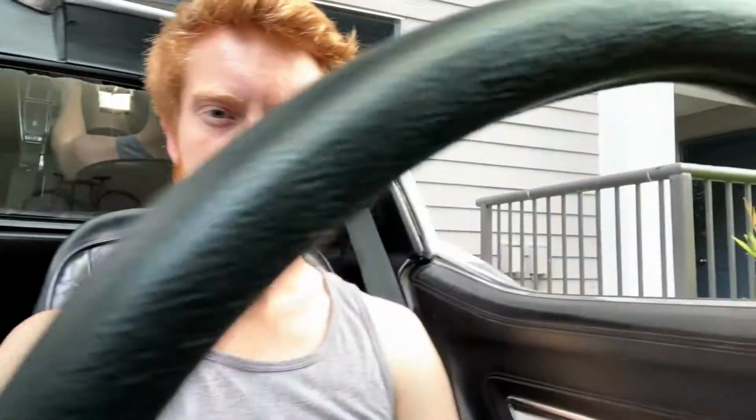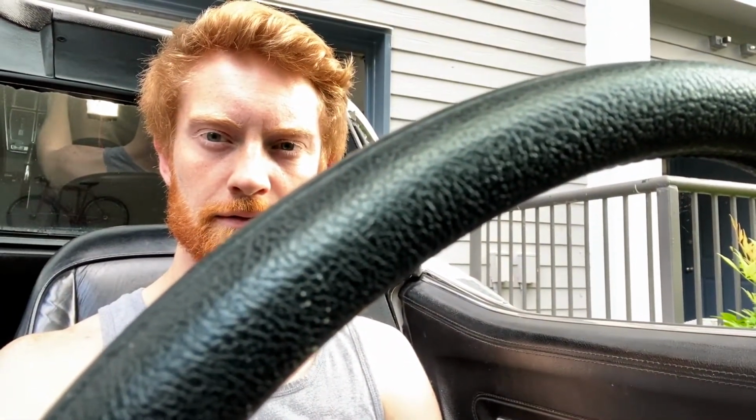Startup was a little funny. I'll say, unfortunately, the car feels like it's actually rocking a little worse than before. So here's my guess: one of the 8 spark plugs, or maybe more, I may not have gotten the cable on just right, so I might have a faulty connection on one of them. But I don't know. If you can see the steering wheel, shaking pretty bad. That's a bummer.